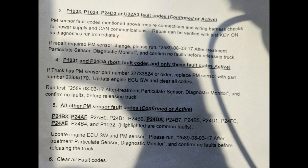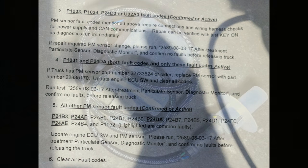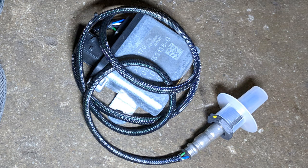With any case where you have to replace the soot sensor, they recommend that you update the engine ECU software. The way these sensors operate is they gather soot over time and measure it at increments. After the measurement is complete, they heat up and regenerate the soot off of the sensor and begin this period again where they accumulate. It's my understanding that the regeneration process where the sensor is supposed to clean itself was not taking place properly, and the sensor would not clean the soot from itself and begin another cycle — at the end of that cycle it would obviously fail because it had twice the amount of soot built up on it.